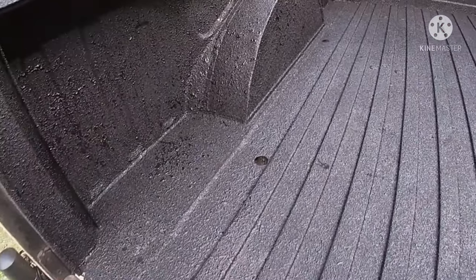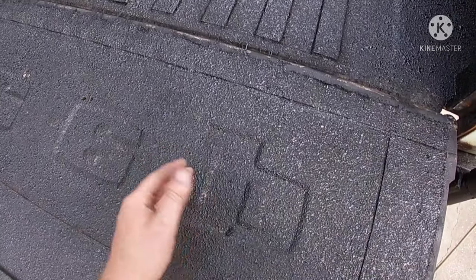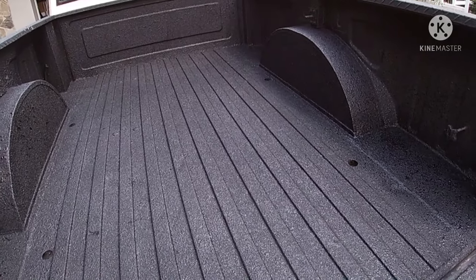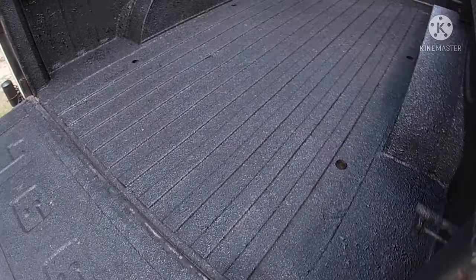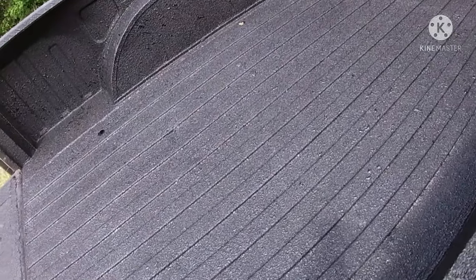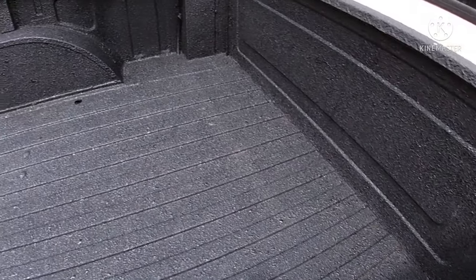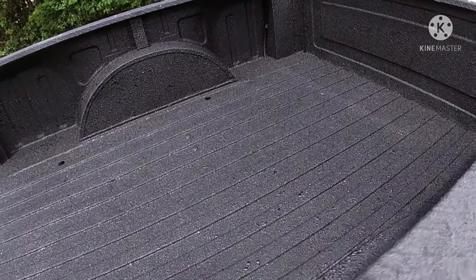That's all there is to it — it's all done, just let it dry. This stuff actually dries really quick. It'll probably be ready to use in no time — it's already dry after only about 15 minutes. It's a little tacky still, but sitting in full sun it'll be dry in a few minutes. That hopper is the key to making it look like a professional job. And that's the cheapest bed liner you could buy — it's from Harbor Freight, used to be like 50-something dollars a can. With these results, it looks pretty good. For the price it's a lot better than three or four hundred bucks for Raptor Liner. If you like this video, give it a thumbs up. If you really liked it, subscribe — I'd really appreciate it.